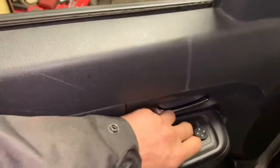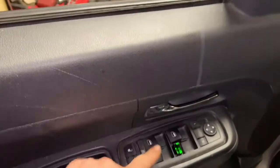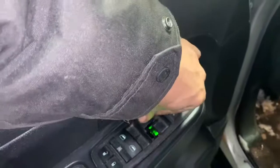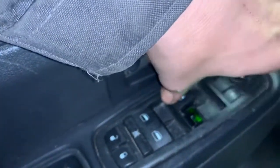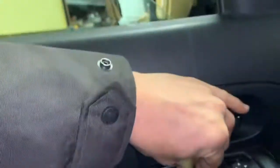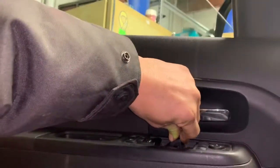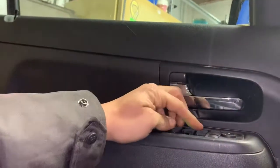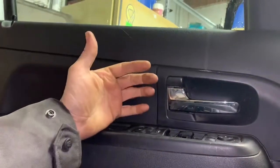But in this situation, our window — we pull it — does nothing. So what you're going to do, and I'm going to try to demonstrate this, is you're going to take your finger and put it on the back side portion of the switch and pull up. It doesn't work every time, and obviously it's difficult for me to show you an angle where this works. But if I push down on the back of here and pull up on the front like it's supposed to, that creates the contact and makes it work.